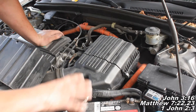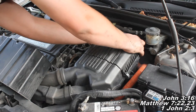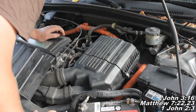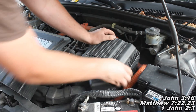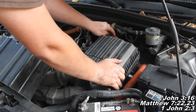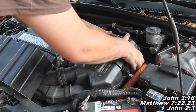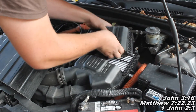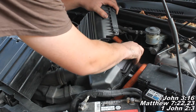The first thing I want to do is locate your air box, which is this piece right here. We have a total of four clips, and you basically just got to undo these clips — one, two, three, and four — and we just pick up on this box right here and get it out of our way, just enough that we can pick up our air filter and remove it.